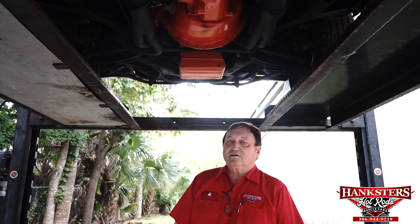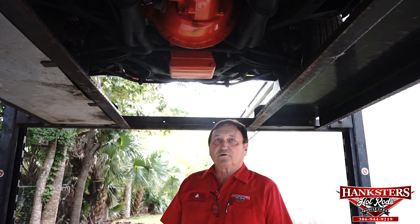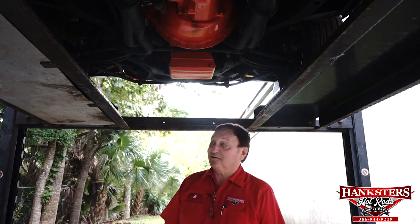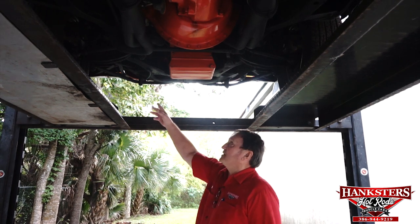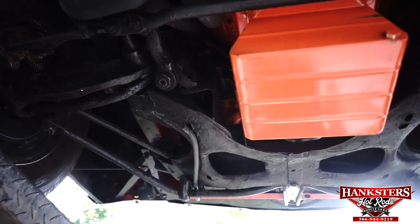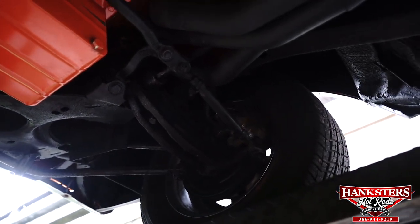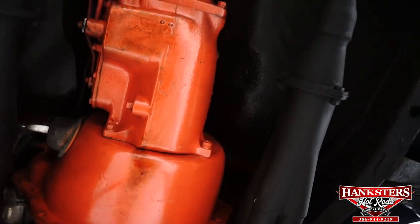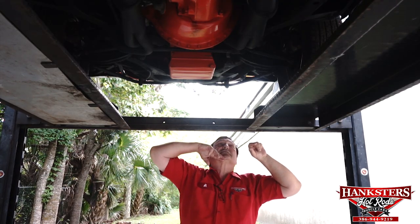Hi, we're underneath our 1969 Plymouth GTX 440 Air Grabber 4-speed Dana rear end muscle car. Now this is a car. This is serious Detroit muscle here. Heavy-duty sway bar in the front, heavy-duty torsion bars on this vehicle, disc brakes in the front of this one, new shocks in the front. Subframes on the car are absolutely as new. They could not be any nicer and fresher than they are. The steering system itself, your tie rod ends all look nice and clean and fresh.